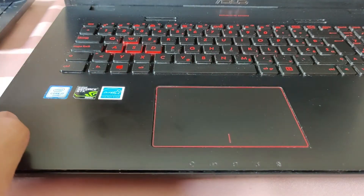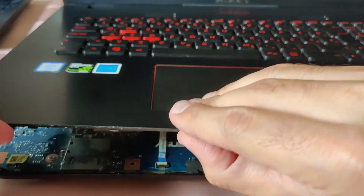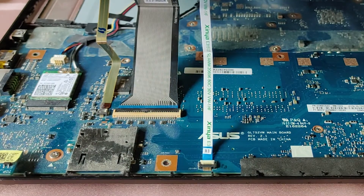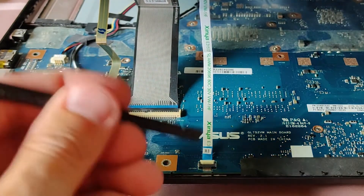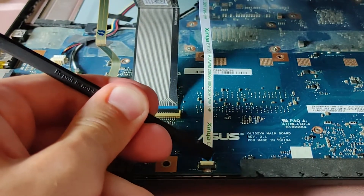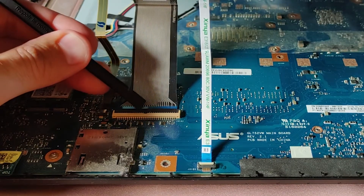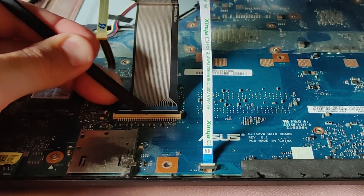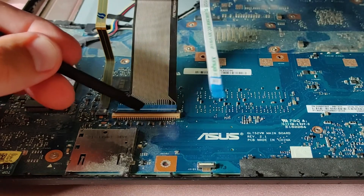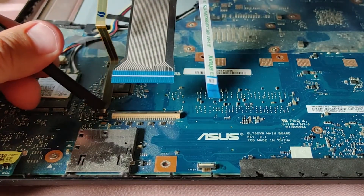You should be aware of the three sensitive connectors being attached to the motherboard — this one, this one, and this one. They have a retainer clip and you should pry them loose like so. Just the right amount of force necessary like this, and the connectors come off easily like so.